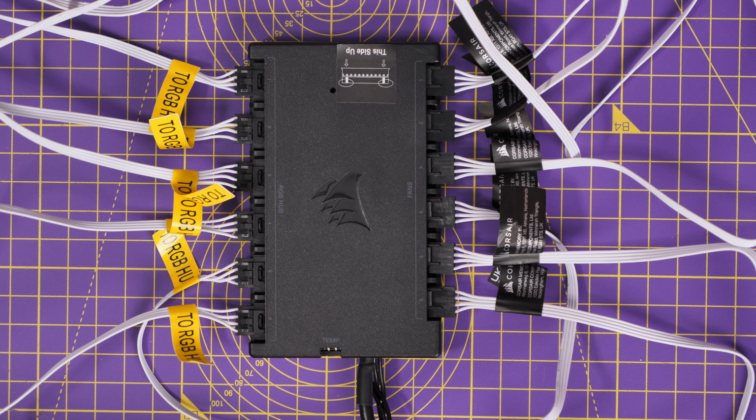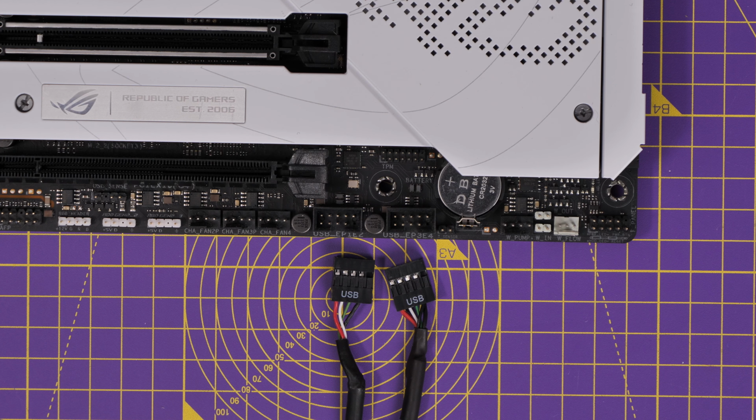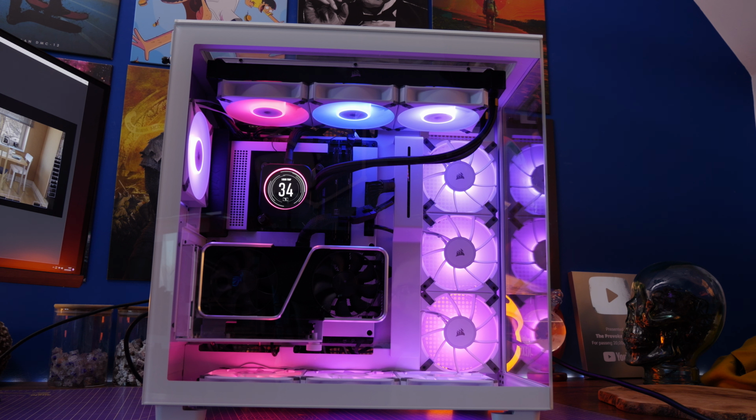However, as I said, you can plug in 6 fans into this. So if you have 10 fans, you might need 2 controllers. Then you've got a SATA power connection and a USB connection for each. You might end up with 2 USB connectors, and maybe you've only got 1 on your motherboard, so you might need to buy a USB hub, a powered one. Corsair does them, as does NZXT. I've used both and they're both pretty good, so I'll leave links down in the description below so you can find out more. But those are the easiest ways to get those fans wired.